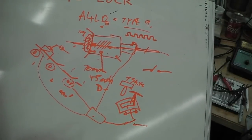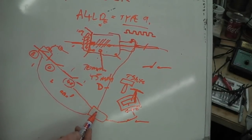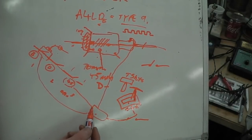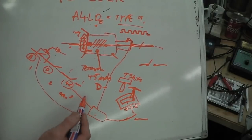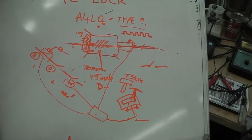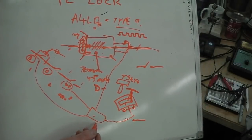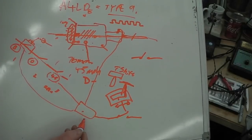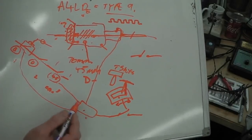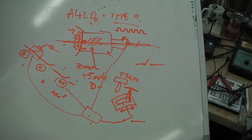Okay? And as a double measure, not only when we go between 45 and 40, let's say we choose those, but we're going to make it adjustable so we can adjust the cutting points of the cruise lockup, of the torque converter lockup. So I can have a little pot, or potentiometer, a variable resistor. I turn it with a little watchmaker screwdriver and I can adjust my range, so I can go out in the car and calibrate it exactly how I want.